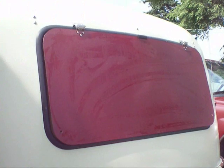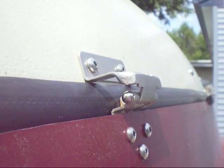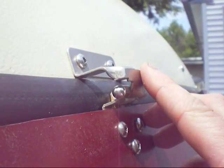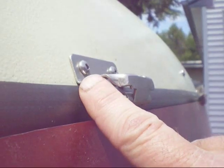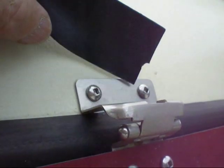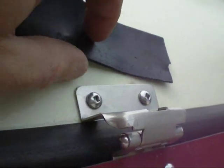I've painted my old window covering. This one is actually mounted on here right now — I'll come in close so you can see how I did it. I've taken the offset hinges, lined them up on the window covering, drilled the holes, and bolted them on. Then I set it up against the trailer for measurements and drilled through the trailer. I wanted the offset so it would come out over the rubber beading. Underneath I'm going to use some rubber friction tape as a sealant, put the bolts back in, trim it to size, and that should keep out any water. That was done on both sides.